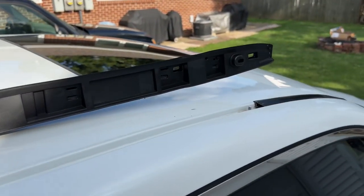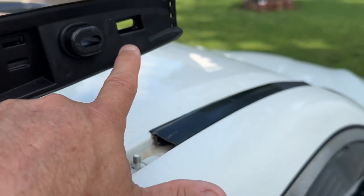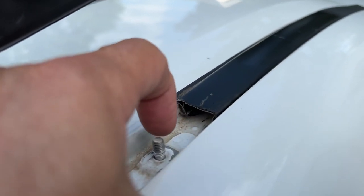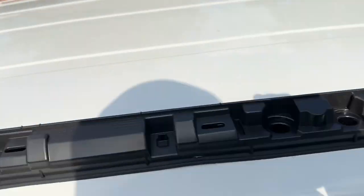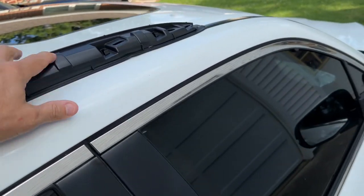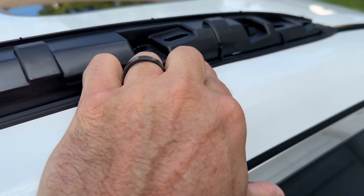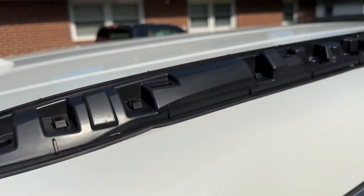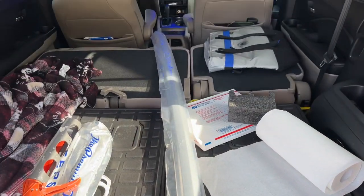Here is the bar turned on its side. See the two holes here, two holes there, and one hole here. This is going to cover that no matter how bad of a job, but you only have about four inches, so you only want to cut this about an inch and a half to two inches. We just put this over like that and it fits perfectly. There are a couple of tips and tricks. With the rubber, see how it's kind of pointed up — as this heats up, this will lay flush and conform to your car. After we're done mounting, there's a piece of chrome plastic that locks in and then we'll do the sidebars.